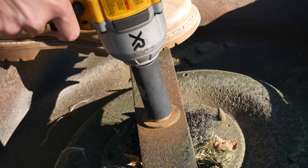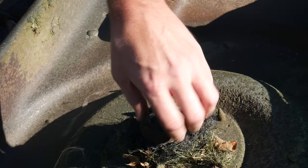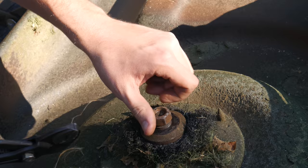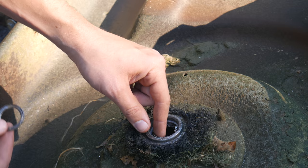Although this one is just comically bad. Before removing the blades we'll clean up the fastener a bit to make sure we can get a socket on it. Luckily we can and we have the impact gun to make spinning it off easy. Then we can remove the nut, the small washer, and the large flat washer before removing the blade itself. We'll remove some of the detritus that had collected under the blade and try to knock out the spindle shaft. There's a fair amount of rust in the splines so these are a little bit stuck. We'll thread the nut back on to make sure we don't mess up the shaft's threads - would a hammer have made this easier? Yes, but where's your sense of adventure.